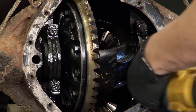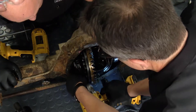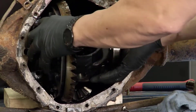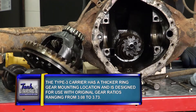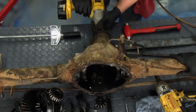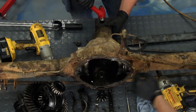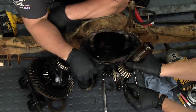Now we can finish taking these caps off. Spider gears look respectable too. I'm betting on the pinion — I'm hoping it's in good shape. There's enough metal fragmentation and shavings around here to know that something very bad happened in the rear end of this '79. When you're taking this out as well, mark the shims — I got shims on both sides, very very important. The pinion's in there. Brian, why don't you take that nut off back there? If you don't have a buddy to help hold this, you can make a homemade bracket and put it right into the flange to hold that yoke. There we go — nut's off. Now use a puller to get that off. Since ours is destroyed, just give it a couple of taps. Oh, it's coming right out — there is our missing piece. That is brutal. That whole thing was clunking around in there — bearings, the whole nine yards, crushed collar.